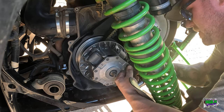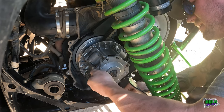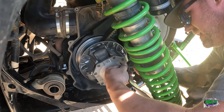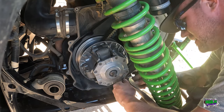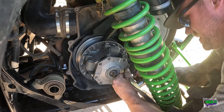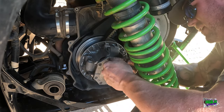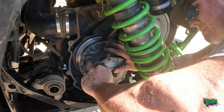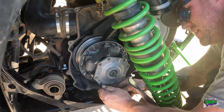I'm going to give them a little tighten - a little star pattern tighten, kind of like you were doing lug nuts on your car. I wouldn't do them all right next to each other. Again, I'm no mechanic. That's just what I would recommend. Call that tightened off, just a little thumb push, because it's aluminum - it strips out easy. I learned that with my Harley Davidson. I stripped a lot of bolts on that one putting that motor back together, thinking everything needed to be super tight. It only needed to be like seven foot-pounds.